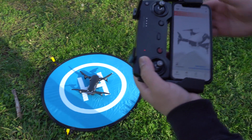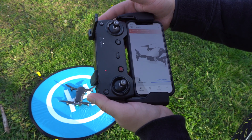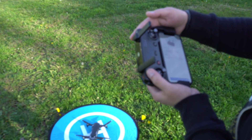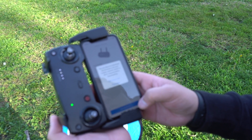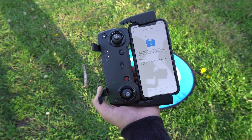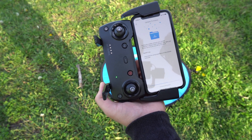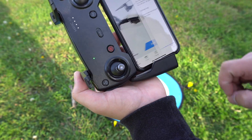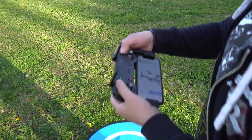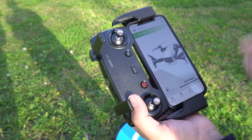Now when it comes to upgrading the controller, it's the same steps as the aircraft. You'll get an orange bar on the home screen letting you know that your controller has an upgrade available. So we'll go ahead and tap on the orange bar and click download now. That little message was that we're downloading on cellular data, which is fine. It'll go ahead and begin downloading the firmware and transfer it over to the controller. Once it's done, you'll get the update complete message, and you'll notice the green status bar that says the update is complete. So we're going to go ahead and power down the controller, and again, I'm going to force quit the app and give that a restart also.